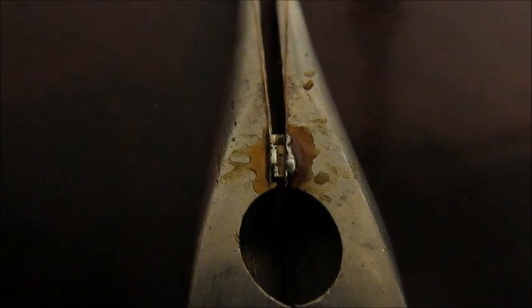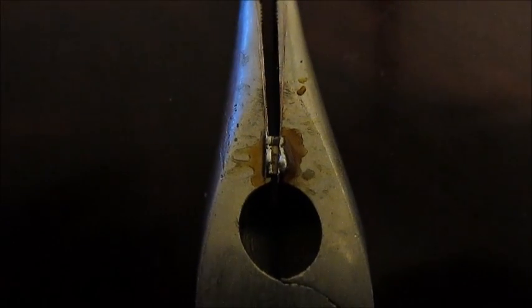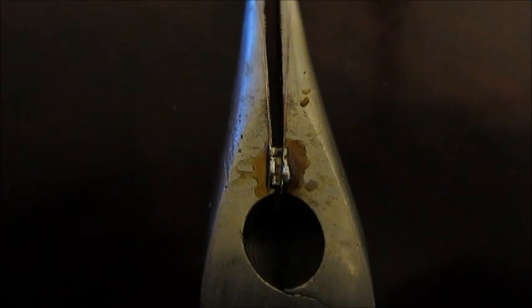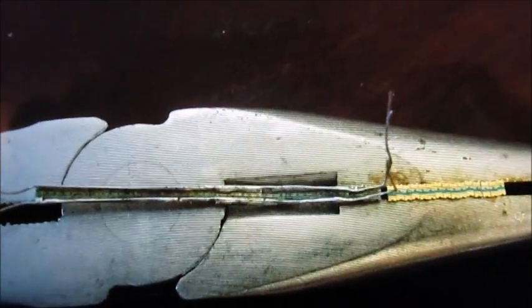Afterwards, when I did do my 36 SMD LEDs and 58 SMD LEDs, like I said, I believe I used an 18 ohm resistor. It was 1/8 watt. I'll double check and verify and get back to you on that. So yes, the resistor used in this was a 15 ohm, 1/8 watt resistor. It's really tiny. I just verified that. And if you want, give me 1 second here. This, if it focuses in, is what it looked like when I was working on my long needle, to give you an idea.